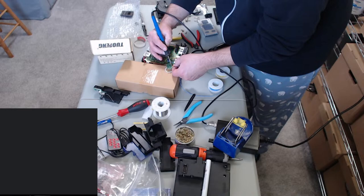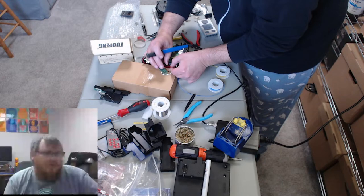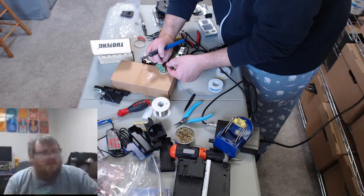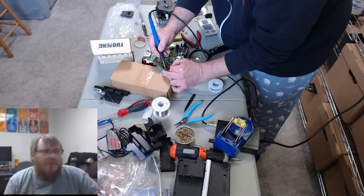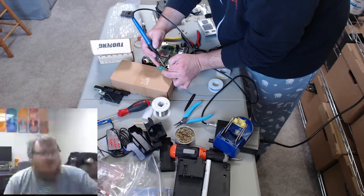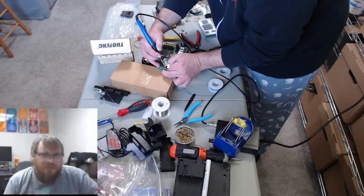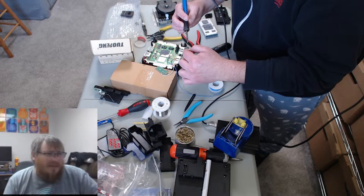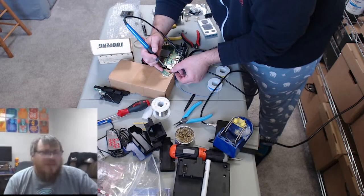Just swapping those over real quick. That was a great idea, Greg. Your compatibility is due to how you're loading your games. The SP2 port on the bottom of the console has a lower overall read speed than the GC loader is capable of hitting, but the GC loader cannot write as quickly, so it takes longer to boot the any of the changes that you make to a game when you start it with Swiss. And I believe the compatibility is still pretty high with the SD to SP2.